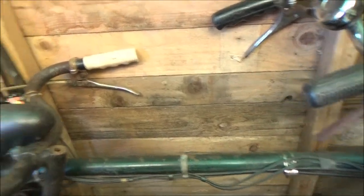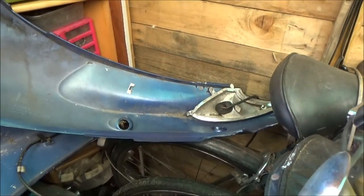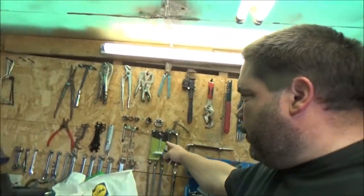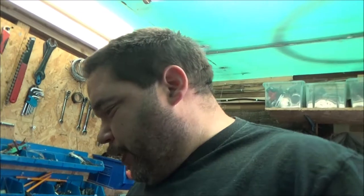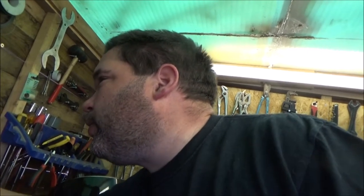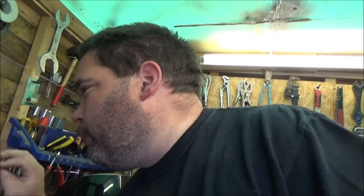The last one under there is my stepdad's Royal Enfield — that hasn't been ridden in a few years either. The last time I rode it, the chain broke. These three-speeds very often have what they call a master link, so they're not machined together as one piece like where you'd need a chain tool to split the chain. You just pop the master link open and take the chain off.